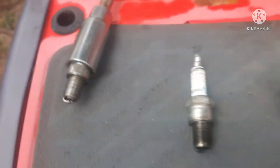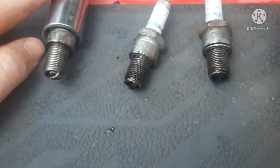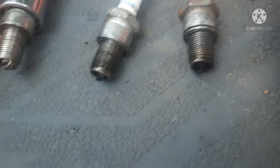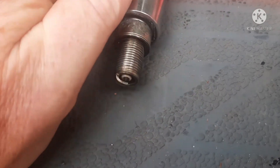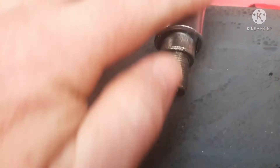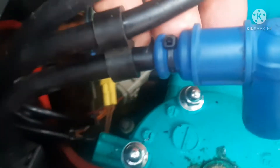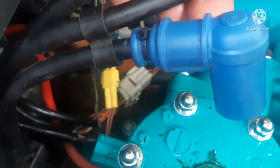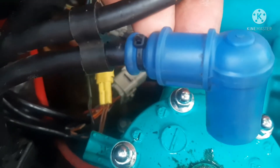Here's another good practice to do when you're checking these cylinders — look at the third plug. I've had a problem with this ski and I think we just found out what it is just by looking at the plugs. You can see how these first two are black — they've been firing. But this plug has nothing on it, it's not black, it looks brand new. This plug hasn't been firing. You can also see there's a different color tie wrap on that boot — this boot had come loose and I had re-tie-wrapped it.